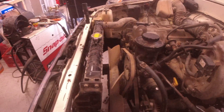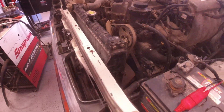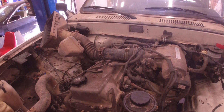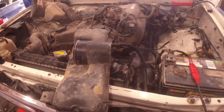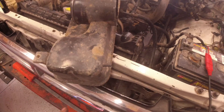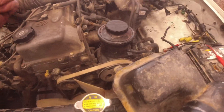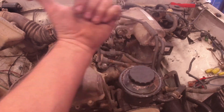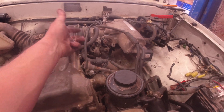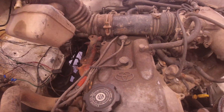I'll eventually make a shroud - I'll probably butcher one of these two shrouds - but in the meantime to get it running I don't really need that. For the air intake, to make it fit better I ended up cutting this section off - just took a cutoff wheel and lopped it off - because you really don't need it. This port goes to the fuel pressure regulator and uses vacuum from air going through the intake, so as long as the hose is on this side of the throttle body it should be totally fine.